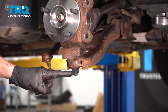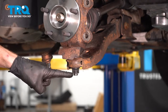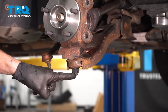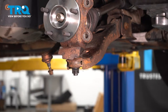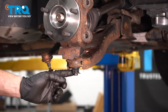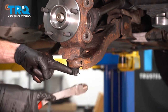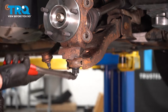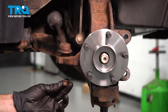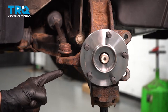Once you have it torqued, the next thing you need to do is pay attention to the ball joint nut. You'll find that it has several slots making their way around. Looking through those slots, you need to try to find the hole that goes through the center stud of the ball joint. If it does not line up, continue tightening your mounting nut until one does. Slide that through, peen it over so there's no way this nut can loosen up while you're driving down the road. Continue on to your outer tie rod end. Slide that into place in the knuckle. Start on the mounting nut, bottom that out, and then torque it to 35 foot-pounds.